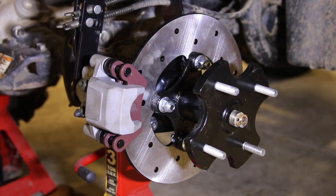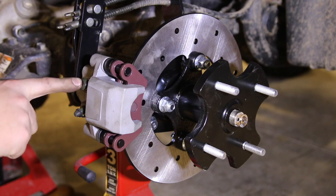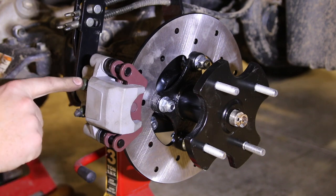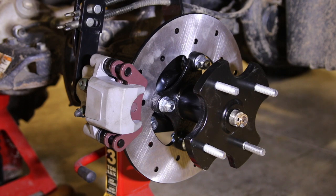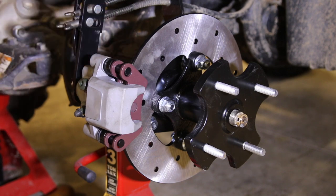I've got to see how all this is supposed to work, but that's pretty much it. Right now I've got this hooked up with a cable, but this can actually go hydraulic — there's the bleeder, there's where the banjo goes. We're gonna try it to see how it is with a cable and if we don't like it we're taking it hydraulic. So stay tuned. Thanks for watching, hope this helps some of you. Make sure you put that bracket in right — don't do what I did the first time, do what I did the second time.